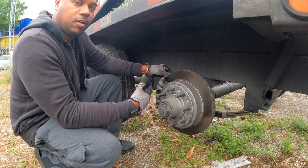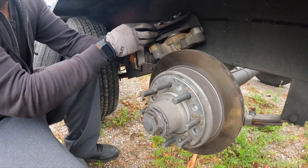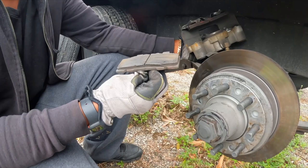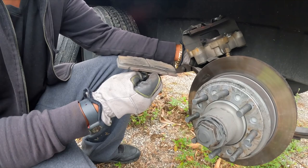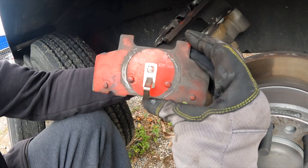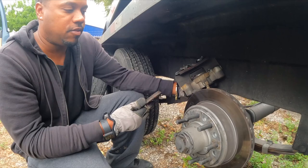So that's about halfway — about 50% — so you're gonna get at least nine months out of these pads. These are a standard GM pad. The part number is KTC 7600 and you can get these from AutoZone. I think they're about $30 a pair.